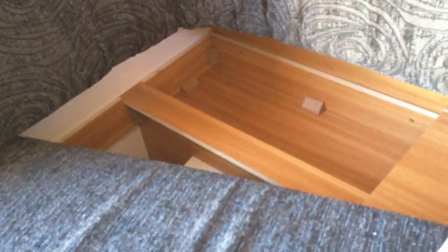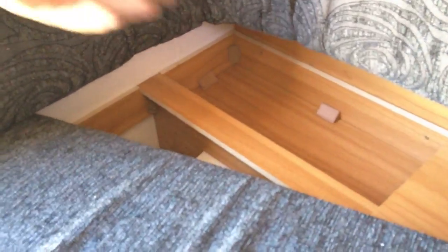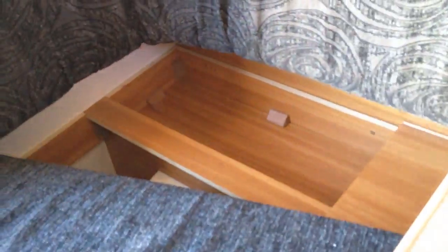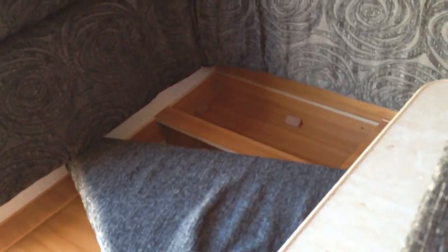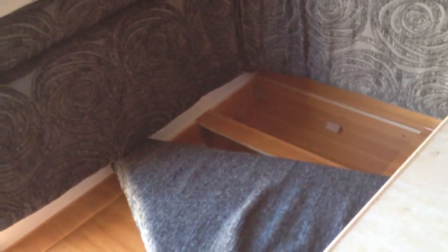And see how there's a cover there? That's just a false plate, because usually you can't access there. Behind there, if you look in, you'll see a lot of cables being run. It's where we've run 240 up behind there. So I've blocked it off, and you can just store things in there if you want. I advise no one to put their hands in round the side under here, so no kids can. All the 240 wires are covered, there's nothing exposed. It's also where the cables are for your winch. Normally this is screwed down, but it's the only place we could fit the hot water.